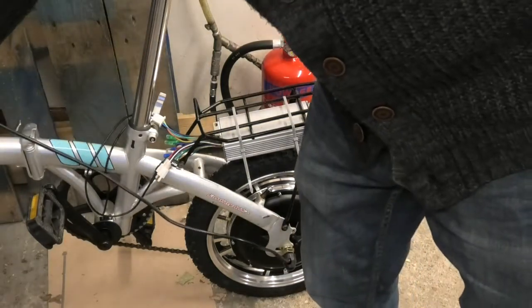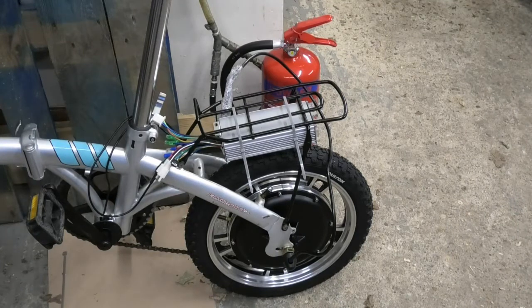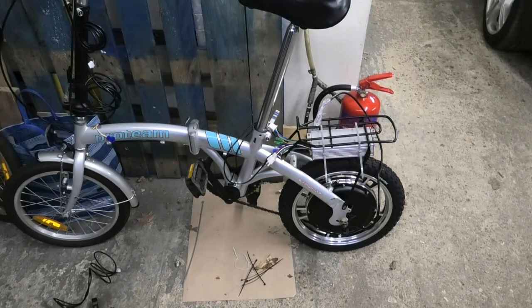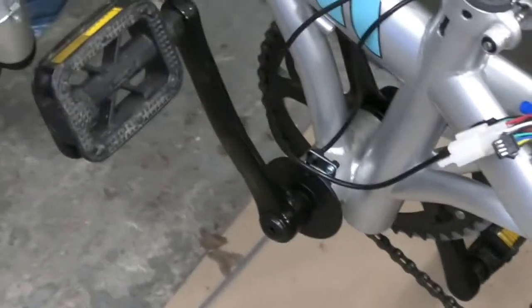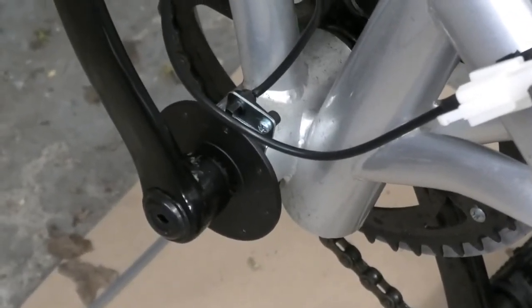I have a feeling I still have to push this in a little bit, so all of this will have to move maybe a little bit towards that end. But so far so good. At the end of the day all of that wiring — from the brakes and that — will go into that controller. So I just wonder whether I should have the controller there or a little bit closer to that end, because there's a lot of wires coming from the front, and from the back there will be the motor wire. The whole thing might just be a little bit difficult to fold if I have too many wires going that way. There is also that little pedal type sensor there which I already fitted — I forgot to mention it.